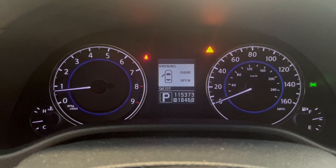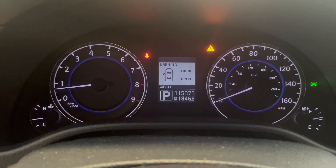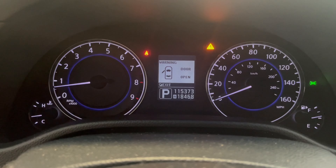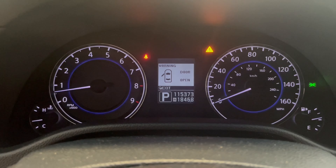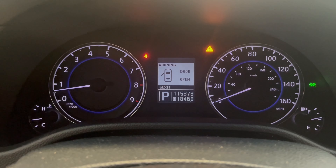It's been running for maybe two minutes and it's still figuring itself out a little bit, but basically getting a nice idle — probably around 650 RPM, which is where it's supposed to be — and definitely a lot smoother. Before, it would especially at stoplights have an idle that would kind of waver. It seems to be nice and smooth again, so we're going to get this thing out of the shop and take it for a test drive.